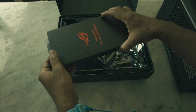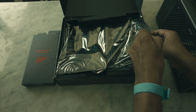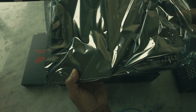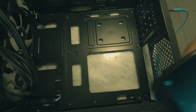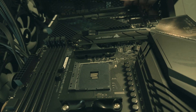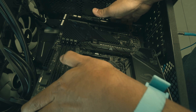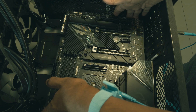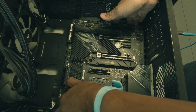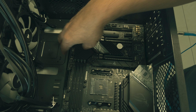We have the Wi-Fi kit and the motherboard itself. You shouldn't be touching the back of the board — behind the circuitry. That's why I'm wearing an anti-static strap connected to the case, which is plugged into the wall but not switched on. Carefully place the board after taking it off the anti-static bag. Do not place it on the anti-static cover because the outside is conductive and the inside is not. There's no harm in keeping the board on the cardboard box it came in.